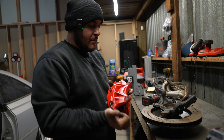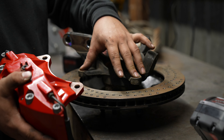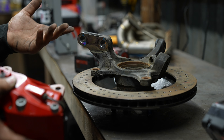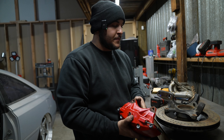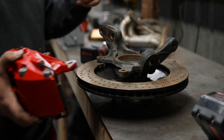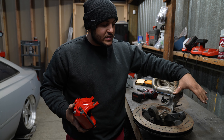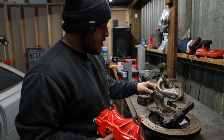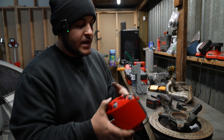The only way I was able to make these work with the knuckle is by physically cutting the stock mounting locations for the caliper on the knuckle and then shortening them to what I need. I shim the spacing between the pads and the rotor using a thin piece of cardboard so it's not physically resting on top of it. Once I like the location, I'll tack weld it. I need to heat this up a lot because it's cast iron — it needs to be really hot for the weld to actually penetrate and stick.